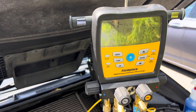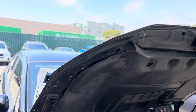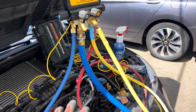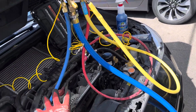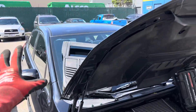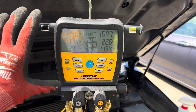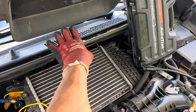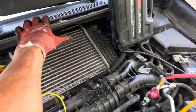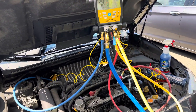The system has been running for about eight minutes now, starting to stabilize but not there yet. It's not a terribly hot day — the outdoor bulb sensor reads about 77 degrees, though we're actually getting about 65 degrees since I'm only measuring here near the engine. The vehicle is sitting in the sun. Here are the normal standing pressures and temperatures. I have it in recycle mode so I'm not pulling in that hot engine heat from the radiator, and I don't have the windows open — I was trying to hit minimum temperature just to see where it goes.